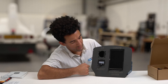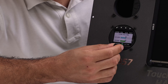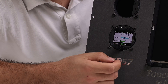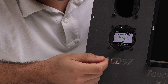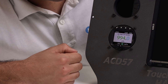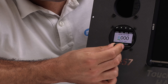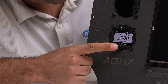Once we're happy with the frequency, we press the rotary switch in and that selects the frequency, loading it into the standby. To change from standby to active, we press the middle rotary switch. To change the radio volume, you turn the small rotary switch for the active channel volume and the big one for the standby channel volume — so you can have dual watch and control both volumes. To set the altimeter subscale, we press Baro on the top right and set the millibar setting. Once happy, press Select. For the transponder, press the Transponder button — the small rotary switch changes the number, the large rotary switch moves the cursor position — then press Select.